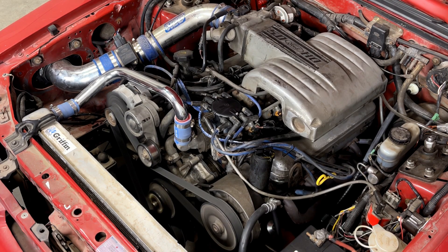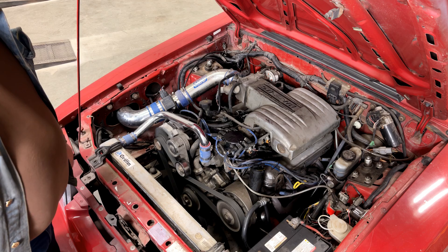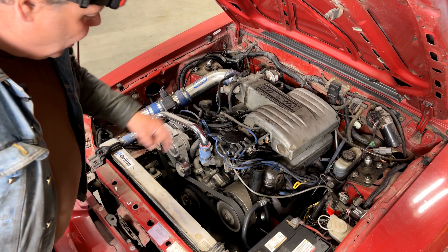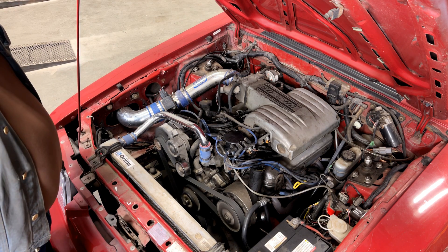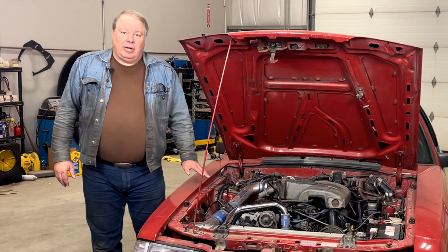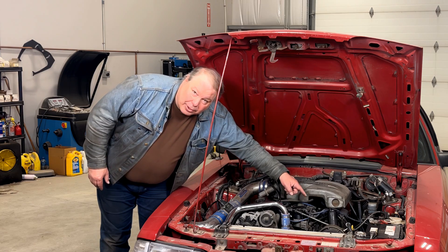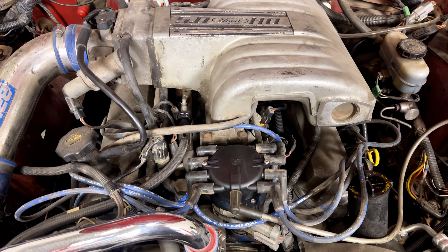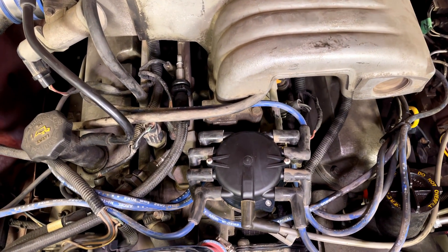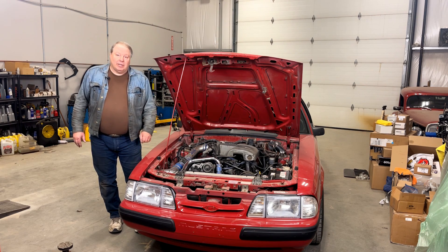Fires right up. Look at that. Five liter Ford with a crab style distributor cap — low profile, small diameter, running. That's all it takes to put this low profile, small diameter crab cap on your Ford TFI distributor. It's about an inch and a half shorter at the top and about an inch and three eighths smaller diameter around the fat part of the cap. If that much extra clearance is all you need to make your manifold, fuel rails, or other devices around the distributor fit, then this cap and adapter kit is for you.